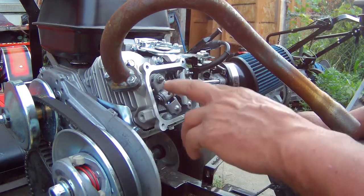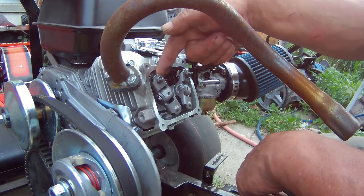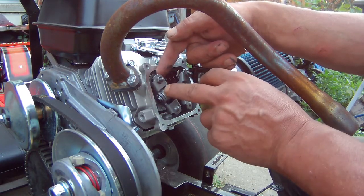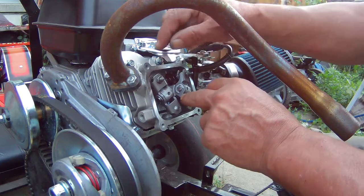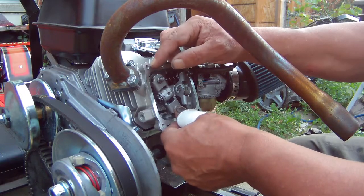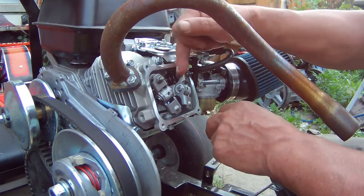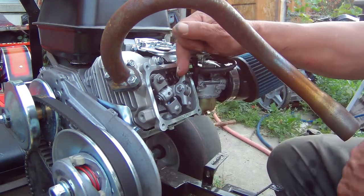What I'm also gonna do — I hear a lot of people on YouTube say when you replace the springs and put the rocker arms back on, you always gap it at eight, some people say six, some say seven. I'm actually not going to go by anybody, because who the hell knows who's right or wrong. So what I'm gonna do is use a feeler gauge and check the gap before I do anything — what these are set at right now — and then I'll put it back exactly the same. I think that's the best way to go.